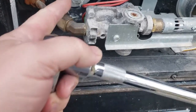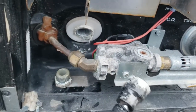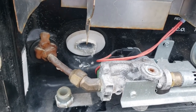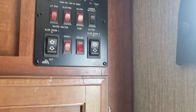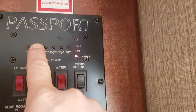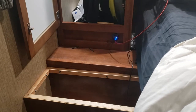When I run water through the hot lines, it just comes up here and back out this way. You also want to make sure that you drain your water heater — that little plug right down here goes up inside of there, and I just use a large socket that fits right underneath. I already had mine drained from the last time we went out. I try to drain my water heater each time we go out to make sure we don't have any funky water in there. Also make sure the main fresh water tank is completely empty, as you can see here. Everything should be empty and good.